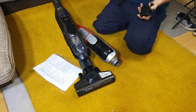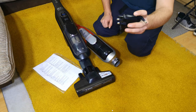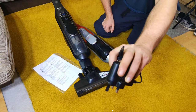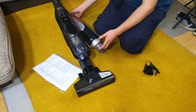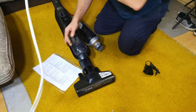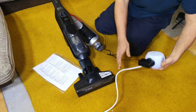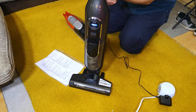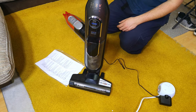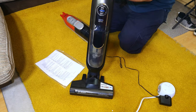It's not because they don't work, and that's as far as he goes. So this is where we come in. I'll start off by saying that this is the charger and it does work - it outputs the voltage that it should from the pin, so that is number one ruled out. They also both do things when you plug them in, which is very strange. I don't actually quite know what's wrong with them, but even if we can't fix them in this video I'm hoping somebody else would have seen it. It sort of tries to turn on, and as soon as you plug in power it dies. It doesn't really do anything - it certainly doesn't look like it's charging - and it's now completely dead as soon as I unplug the charger.